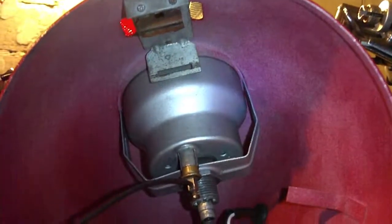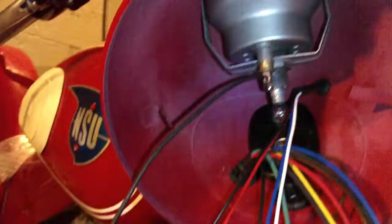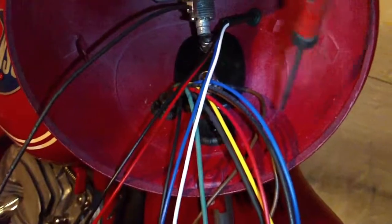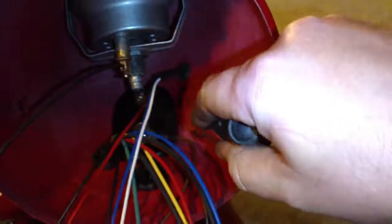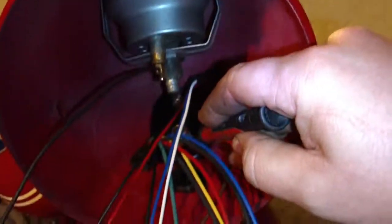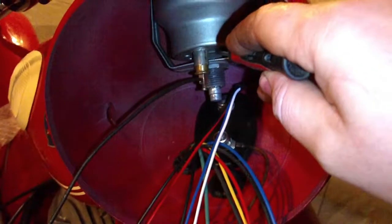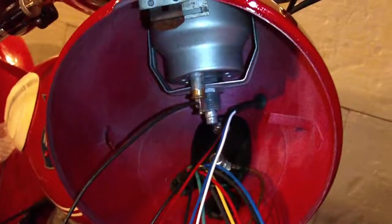And also there is a possibility that you will not have contact, because under this metal plate is a shock absorbing rubber, and as I mentioned before, this part is almost isolated, so there is a chance that you will not have good ground or minus contact. So the best thing to do is to take one wire and connect it here and here. So you connect this bolt and this part here, and we will have a clean and very good connection with the ground, and that speedometer light bulb will definitely work then.